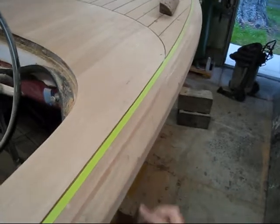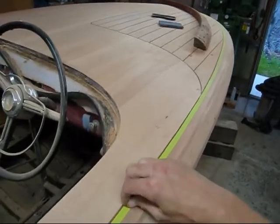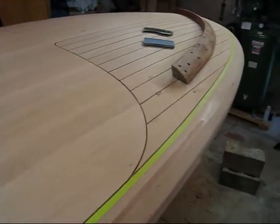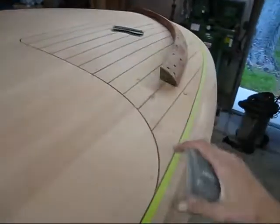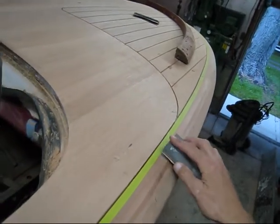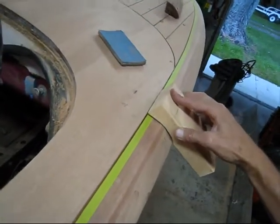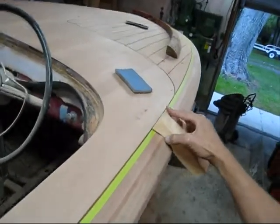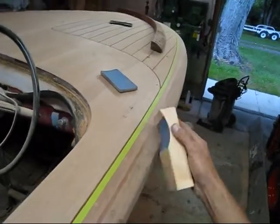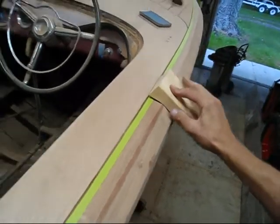What I did was I started out with a segmented piece like this and I put it up here. I have this tape offset here — it's a half inch tape — and I don't want to mess with that area until the very end, until I go to finish sand it with 80 grit, so I'm going to stay away from there. That's why there's no sandpaper on this edge here. I started up front, I put this on here, and I didn't sand all the high stuff off with this. I just set it on here to determine where I need to take out a lot of material.